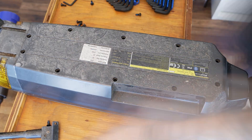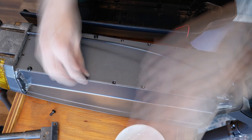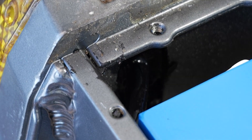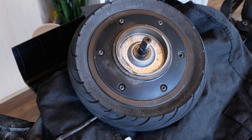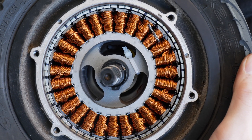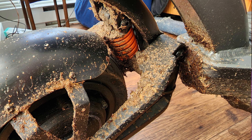So even though it only has half the mileage of the Ninebot Max at 1,200 kilometers, there is no doubt it has seen more rain. I've ridden this in all weather — light rain, crazy downpours, even in the snow, though that usually doesn't go so well. This is a bit different than most scooters. There are two layers protecting the battery and controller. The battery and controller housing is all metal and is sealed up pretty nicely with a supple rubber lining and grommets for the wires. The rear motor cable grommet even has sealant to help prevent liquid entry. I didn't notice anything inside the housing — it's clean and dry. So I disconnected the rear motor. This motor was definitely a bit more difficult to open than the Max. The screws which fasten the motor cover to the rim needed a Torx bit and required quite a lot of force to come loose — I actually destroyed one of my bits in the process. But there you have it: as far as I could tell, there was no visible rust on either side of the motor.